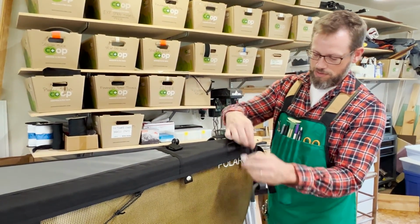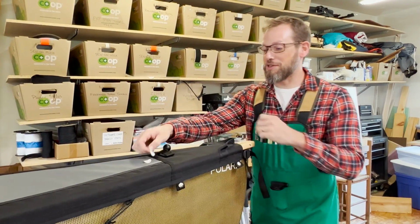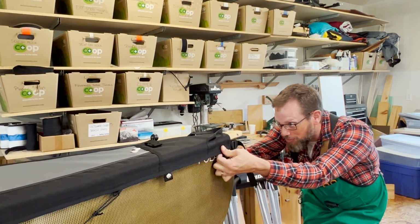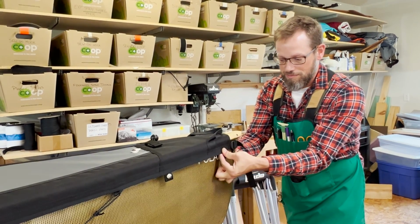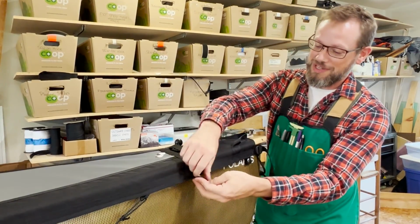Peel off the sticker. Again, this is all because you've waited 24 hours, right? It's important that you make sure the hull is still clean. So you may want to just run some acetone over this again if you've followed the directions and properly waited 24 hours. So again, we'll get the reveal about the same, keeping even tension. Just push and hold these for 30 seconds. And then we'll do the same thing with these.